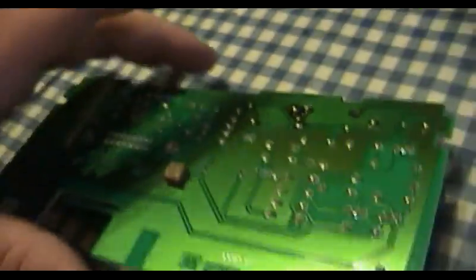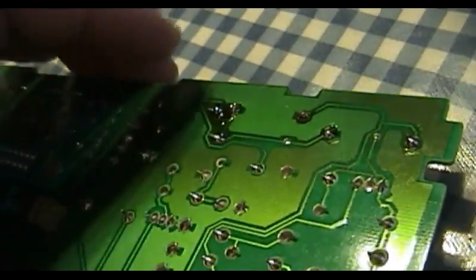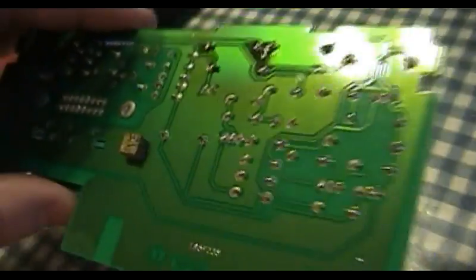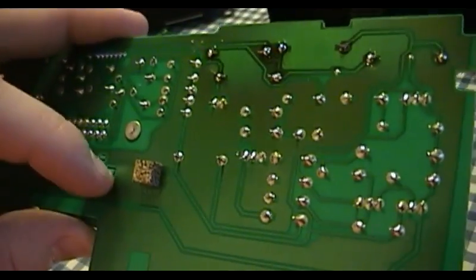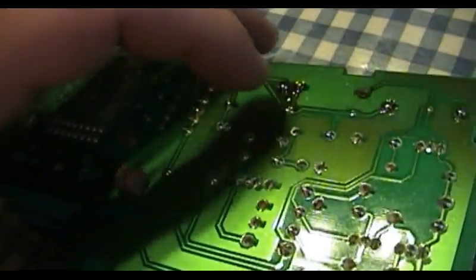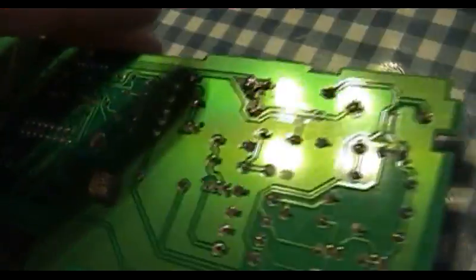So it's entirely possible that if I ever have to do this again, or if you have to repair your own circuit board and you're using this video as kind of a how-to guide, which it certainly is intended to be, that you may have to make some repairs using point-to-point wiring. Fortunately, this is a pretty simple, straightforward affair. It's a single-sided circuit board, so you don't have to worry about a trace connecting to another on an inside layer that you can't possibly reach, or possibly having to scrape off some of this solder mask material and attempt to solder a bridge wire, or a jumper wire is the more correct term, to the bare copper track on the circuit board.